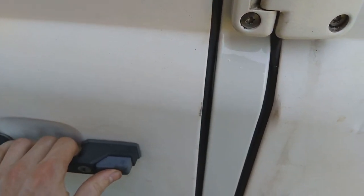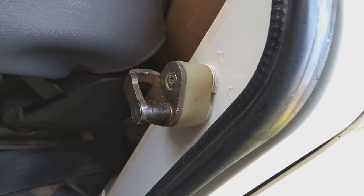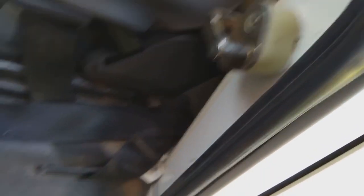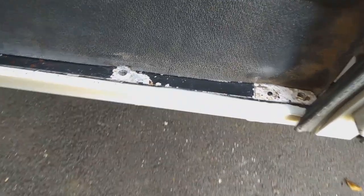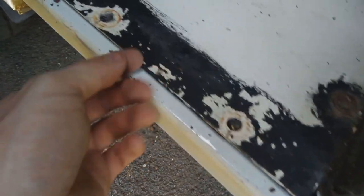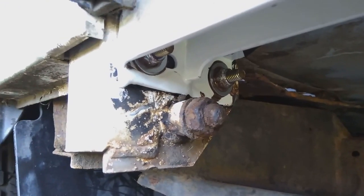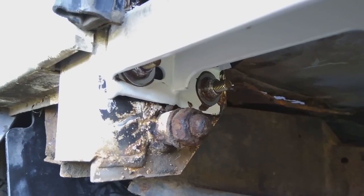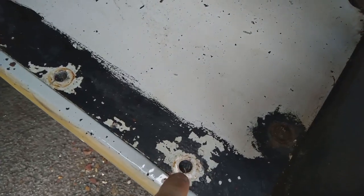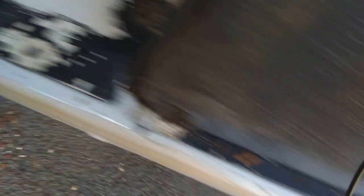The front door's gone on pretty well - no problem here, actually. This one's got adjustment still available, and it's gone back pretty much in the exact position - I measured all this beforehand and put it back in the same position. It's pretty much just all worked, really. These sills went on nicely. I've put PVC tape under here - I didn't do foam. You can see all the crud that comes out of my doors. Worked out a treat with the new stud plate. That worked quite well. And all these holes do line up. I've got PVC tape there but they do line up, more or less. This one's slightly off but you can get a bolt through there. These are okay in here - they all pretty much line up on the sills, so those holes are in the right position.